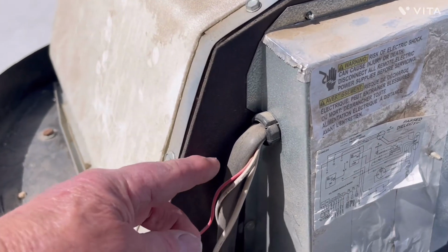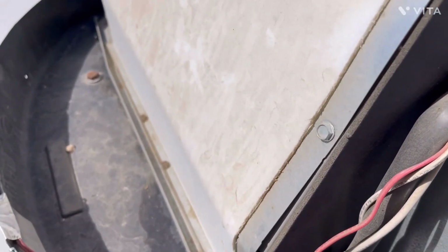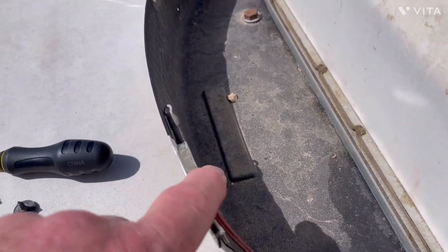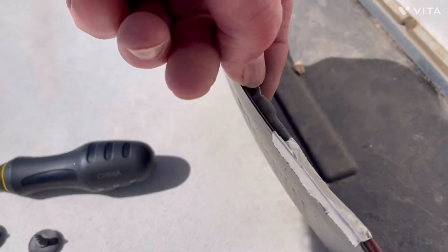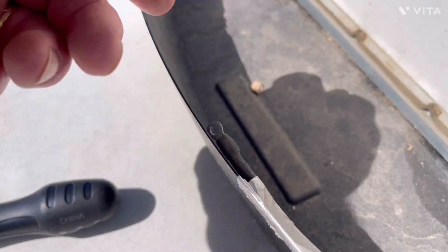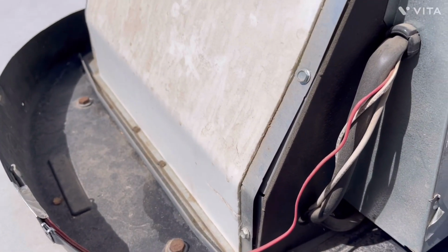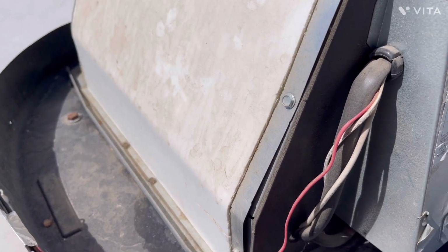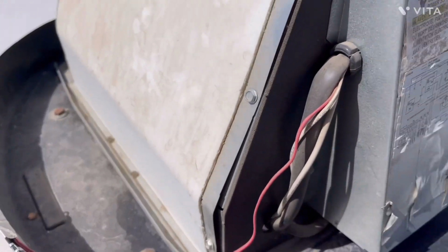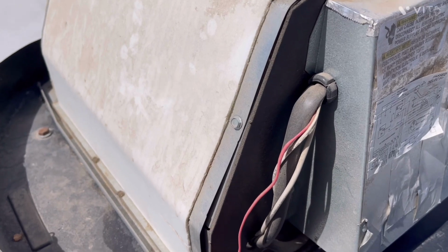And also on this older Dometic unit, you'll see that there's a single red wire that runs around up to the front, and you'll see a non-coupled terminal end on here, and this is the outdoor temp sensor, which would tell me the outdoor temp if there was a sensor connected to it. So there's no sensor connected, obviously, to the end of the terminal, so we don't monitor the outside temperature.